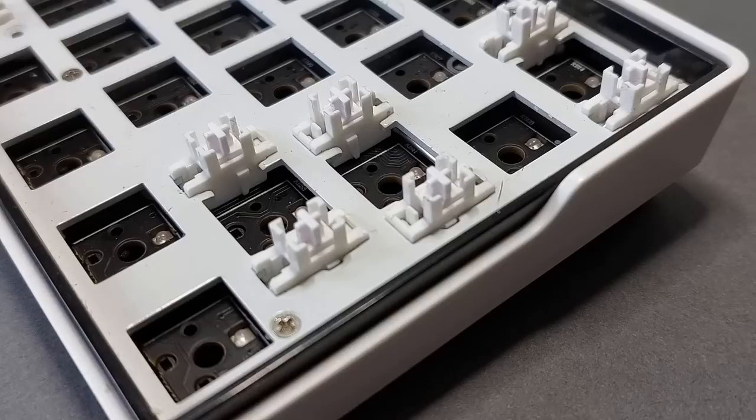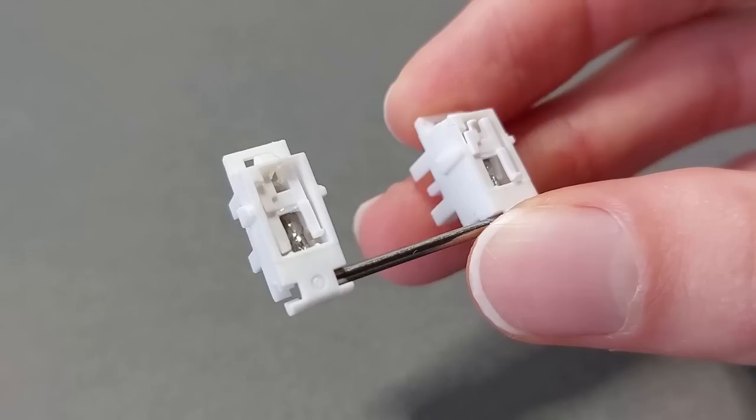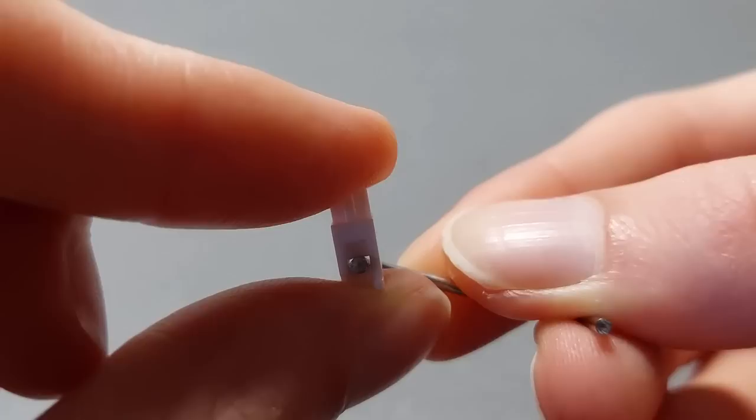You can easily remove these by simply pushing on the little tabs on the far side. As you can see, these are fairly generic white stabilizers, which have already been lubed, but only on the wire, but are not clipped, and haven't had the housings lubed. I was planning to band-aid mod these stabilizers, but as you can see, the wire left very little room, so